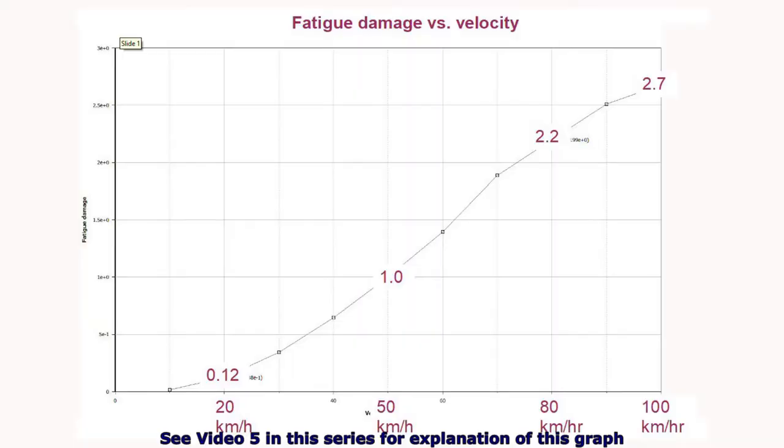And if you do feel the need to crack on in order to get home early, bear in mind you have been putting a lot of fatigue damage into the suspension. Other obvious items: use the right tyre pressures and reduce the tyre pressures on bad roads — this reduces the dynamic loads going into the suspension. You stick to the GVM, the gross vehicle mass. When fitting parts to the suspension, all of the critical items need to be of manufacturer's quality or better.